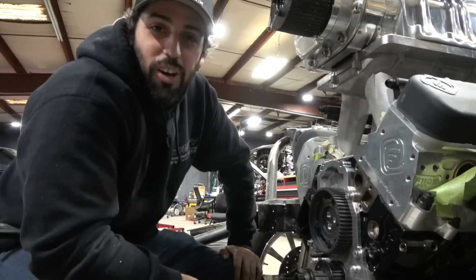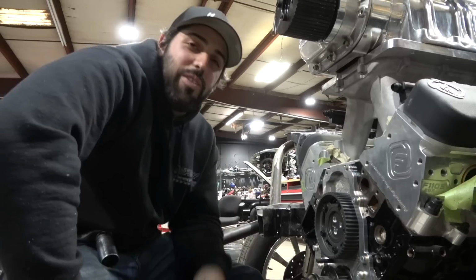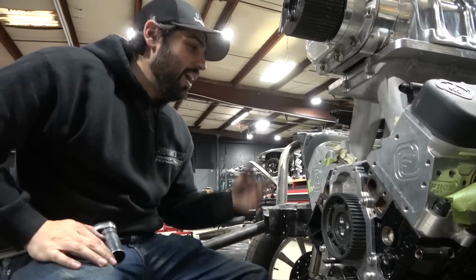Well, guys, that's how you install it, okay? Just make sure it's dot to dot and then degree your cam from there. I'm wrapping this video up. Sounds good to me. I'm wrapping this video up.